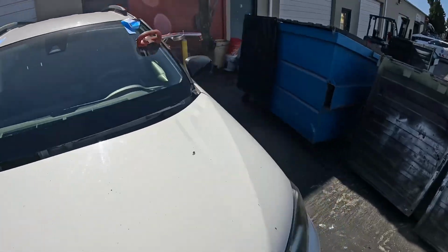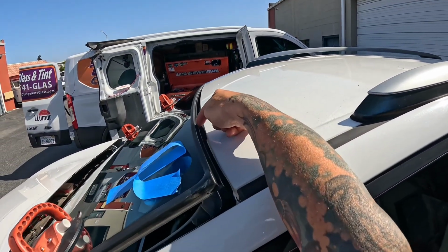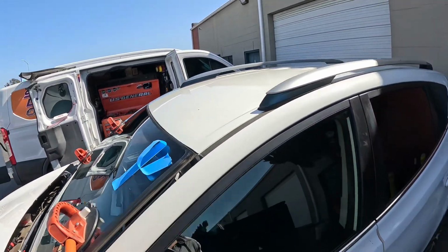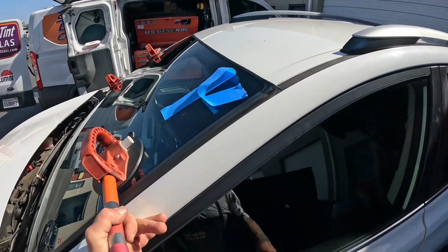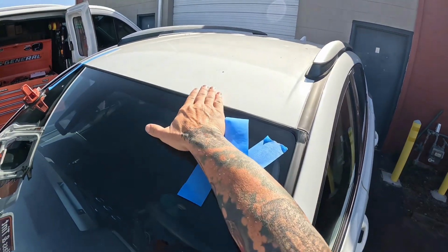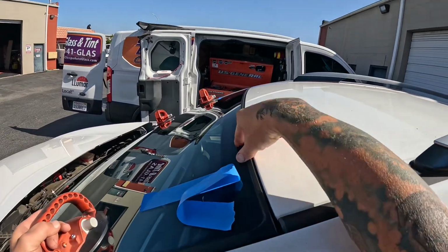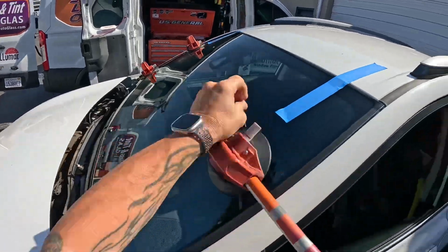And then we'll move over to this side and do the same thing. We're going to watch that top, make sure this lip hits the top edge here, and make sure this lip hits the side of the pillar here. So watch that as we drop it in. And then right here, we're just rolling up nice and easy. Let that slide down a little bit. Make sure we've got a nice little roll on our molding there. Lock that one in place.